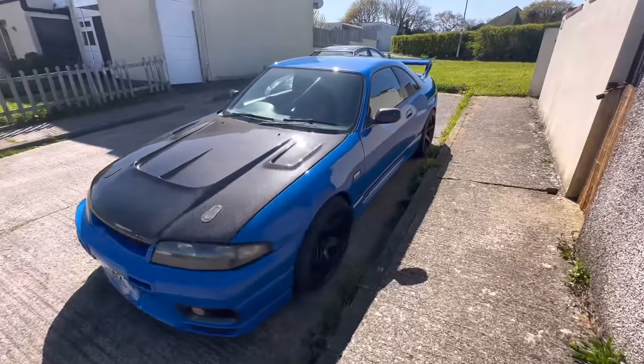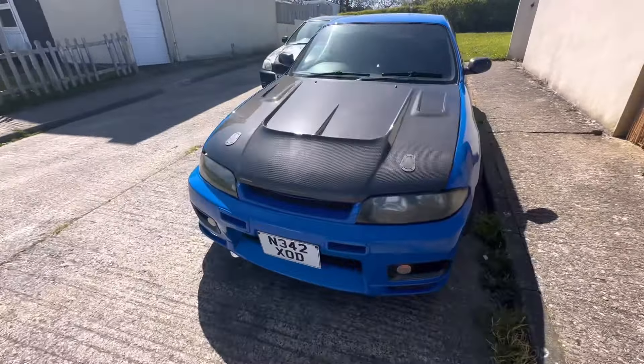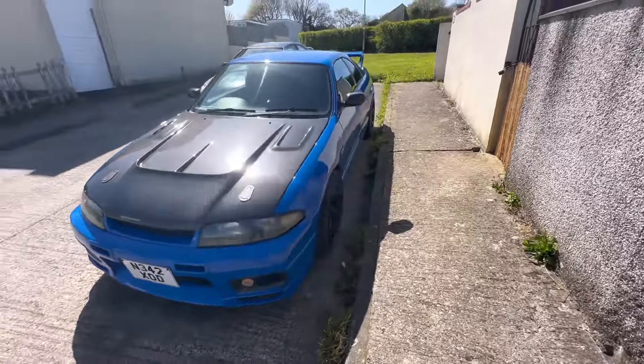We didn't actually go for a spin that day. There's a cruise tomorrow, so I'm combining this video with that — we'll do a little drive, go to the hospital to give some sick kids some toys. Before that though, the car's been running rich for about six months, which has obviously killed the spark plugs and contaminated the oil with fuel. The tuner said to do an oil change, and it's better to do frequent oil changes on fully forged engines anyway. Damien's coming up with his yellow Skyline and we'll do the same on his car.